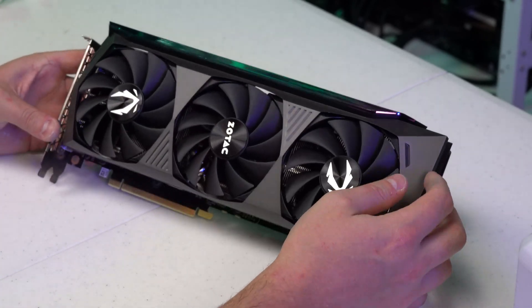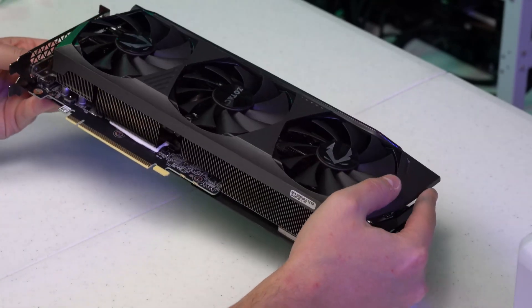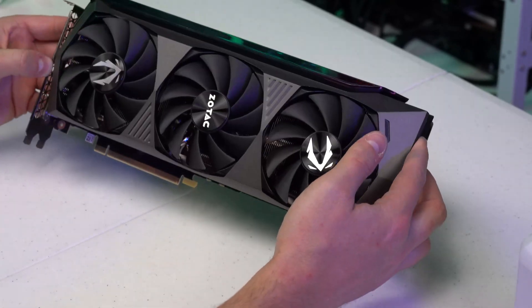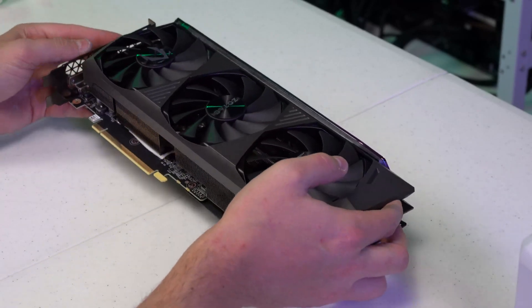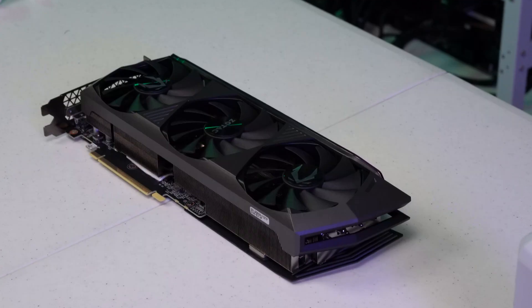Since I had the card apart I decided to go ahead and do the back as well. The 3090 of course has a ton of memory chips and tons of thermal throttling issues, and these 20-watt thermal pads have alleviated all the thermal throttling on those. Additionally on the 3070 Ti's, it greatly decreased the memory junction temperature. I'll throw up a screenshot of the after — doing about 10 hours of testing on the card — and you'll see a significant drop on the memory temperatures.